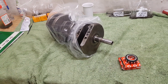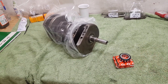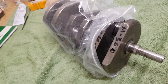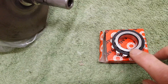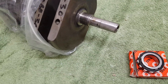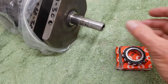I'm about to start work on the crankshaft, putting the con rods on and so forth. The first job is fitting the inner race of the timing side main bearing. I'm going to heat the bearing up and slide it on using an old box spanner that's the perfect size. They have a plastic cage these days, so I can't use a blowtorch as it would melt the cage, so I'm using a hot air gun on a not-too-hot setting.